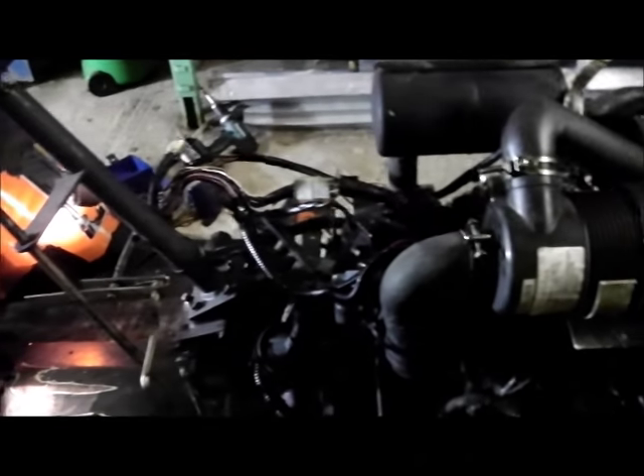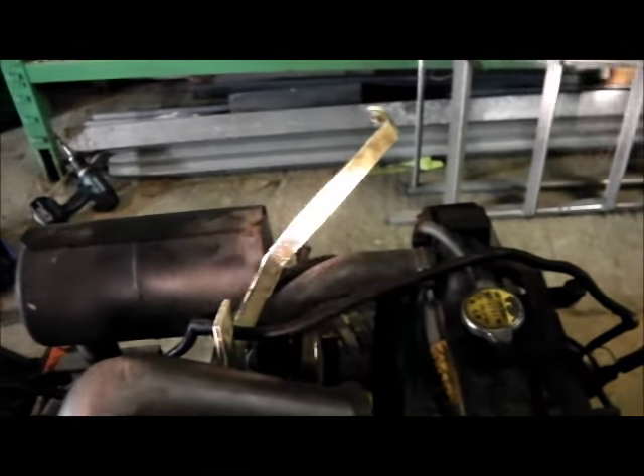It's all fairly rotten, none of it's galvanized, and a lot of the rubber bushes are worn, bolts have dropped out. Of course the bulkhead — everything was moving, the bulkhead mounts were rotten, I'll show you that in a minute. Those outriggers that come off the clutch bell housing were loose, as was that outrigger there which links up to the bulkhead, so everything's just been moving about. A few oil leaks as well, but getting something like this you kind of expect that.